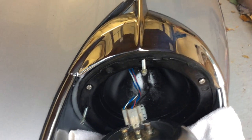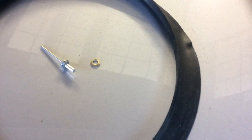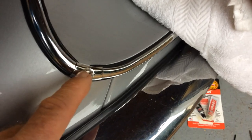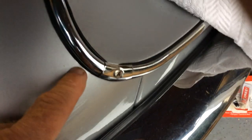The other thing I wanted to point out is this strip that comes all the way down here. When you're fitting that and connecting it in here, be sure that you cut oversized holes in the rubber to fit over the little studs where you have to put in the pop rivets — they're special pop rivets. Use the little washers that sit underneath. You want to lift the pop rivet slightly above where it normally sits — you don't want it flush to the metal. You want enough space to fit in the rubber trim. If you don't, the rubber trim will be really, really awkward. Do persevere with putting it in rather than cutting and bending it. The only place you need to give it a little nick to get around is here — just nick the top edge and it will bend around quite happily.